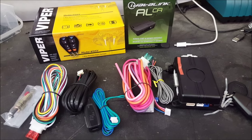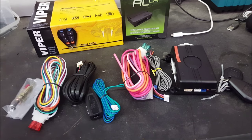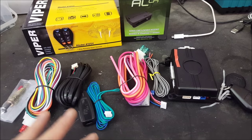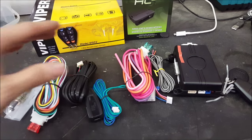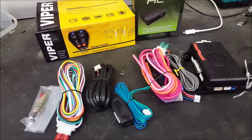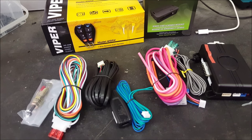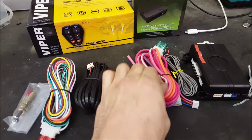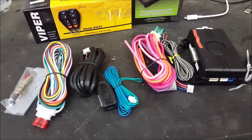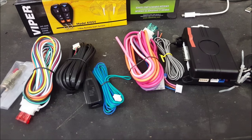A lot of people when they come to the shop think it's easy - you just hook it up or throw it in and plug it in. Well, yes and no. I plug these in here, but I have to build harnessing and then choose which wire, because this is a universal application. What a good install shop does is they prep their harness on the bench and tailor this unit to work in that particular vehicle. So when is the analog starter appropriate? It's when your vehicle is still using ignition wiring with 12 volts on and off. When it's a very rudimentary, simple type of vehicle where you don't have a lot of computer signals telling everything to turn on, the analog starter is actually going to work a lot better.